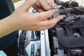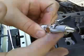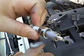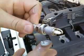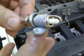Basically I'm putting anti-seize on right now. It's pretty simple — you put it on lightly. This is so it doesn't seize, because it gets hot down in there. You want to be able to remove these just in case something happens to your motor, or you just want to remove them for a tune-up.